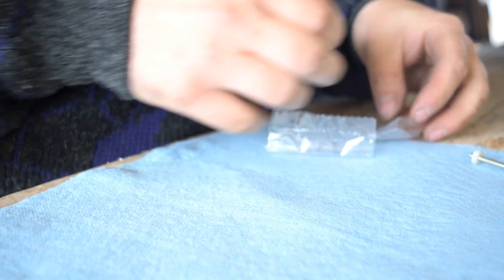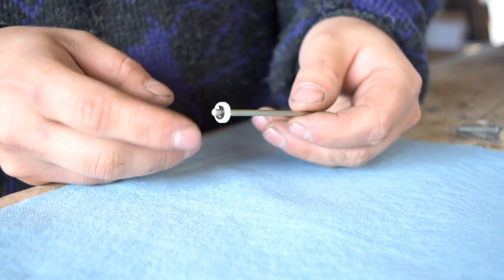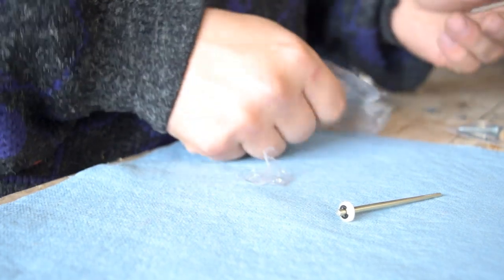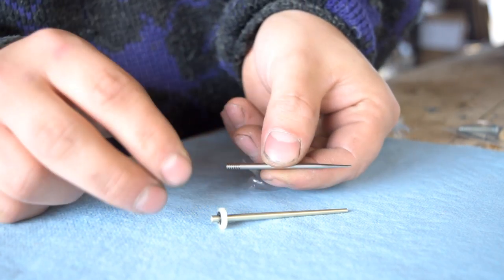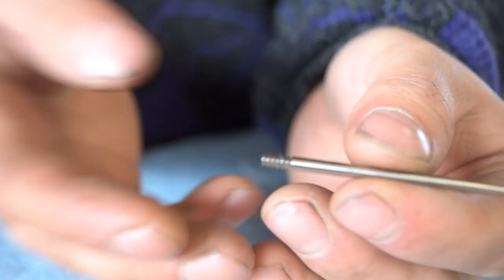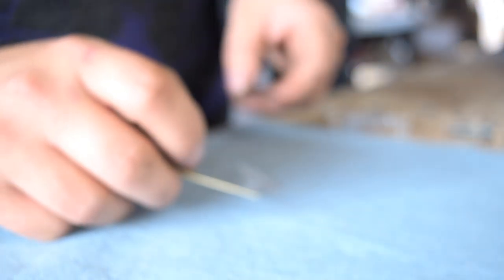If you remember me stating that Suzuki didn't want anyone tinkering with the bike - this is a factory needle with no adjustment. You have a clip, and there might be one slot under that washer but not much going on there. Let's have a look at the ProCycle needle - much different. First off, we have a massive taper compared to factory, and that'll give you much better throttle response across the rev range. It's also a shorter needle, and notice all those adjustments. You have a much thinner needle which is going to allow more fuel, and you also have a lot of adjustments. Big change right there. Now throw that needle back down and the slide back in the exact same way you removed it.